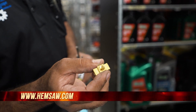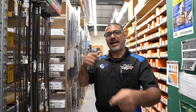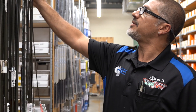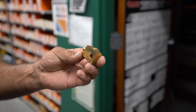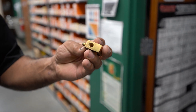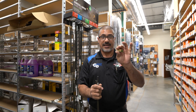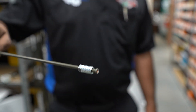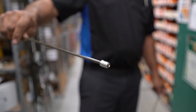We're gonna make new hard lines for the brakes. I need a union and a T for the front, because I'll be coming off one port of the master cylinder T into both front wheels, then going back to the rear — but I need a union for the rear because I don't have brake lines long enough to reach back there. Everything I'm dealing with is metric, so I've got these little pieces that bolt up to the frame. This goes to my Wilwood dash-3, and this is my brake line adapter. Everything I have is metric but this fitting is standard, so I'm going to get some standard fittings, cut off the ends, use those ends where I need them, and use the metric ends on everything that's metric.